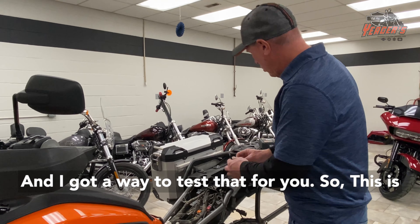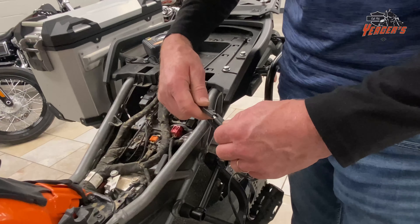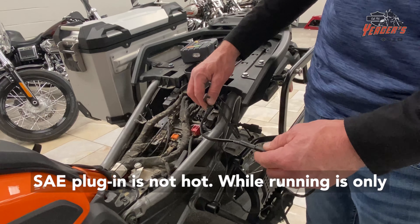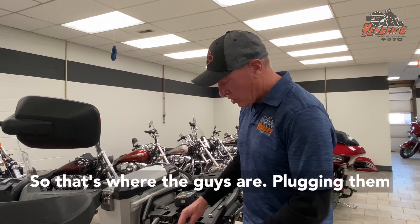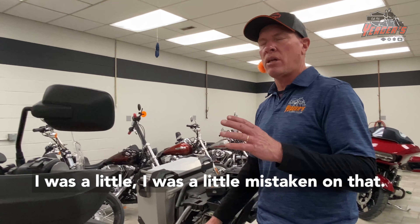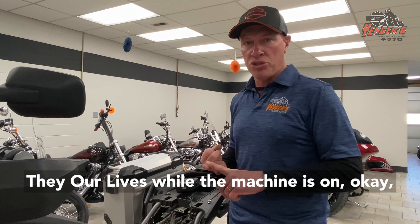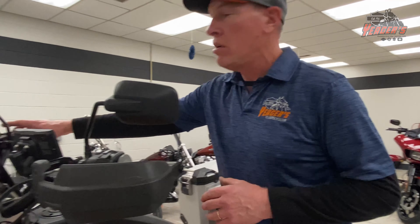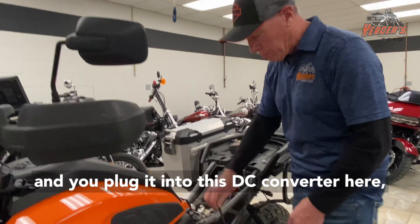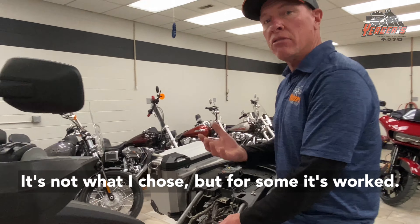I've got a way to test that for you. This is just a tire pump. I'm going to plug it into that. Correction — this SAE plug-in is hot while running, not hot while sitting. So that's where guys are plugging into this — that way it is switched. So let me make sure I'm clear on that, because I was a little mistaken. The heated gear plug-ins, the SAE plug-ins under the seat, are not live while the machine is off. They are live while the machine is on — so it is controlled with switch power right through the main ignition switch.